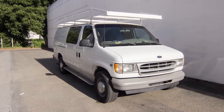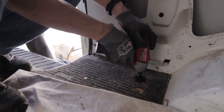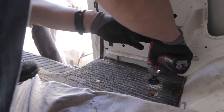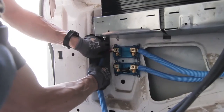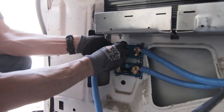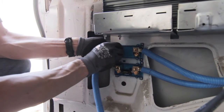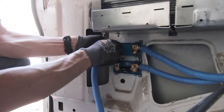This is an example of a typical inverter installation in a work vehicle. The people performing the installation for American Water Heater Service found the work vehicle's secondary battery was located directly underneath the inverter's mounting location, so they drilled two holes through the floor to accommodate the battery cables. They found that placing the fuse blocks within one foot of the battery was not feasible because they would be mounted beneath the vehicle and subjected to water and road debris. Therefore, they were mounted directly to the wall beneath the inverter.